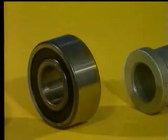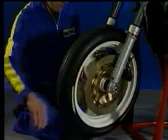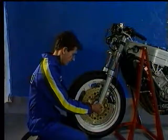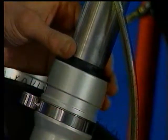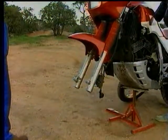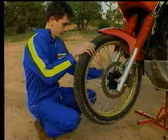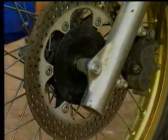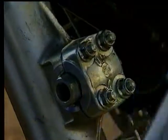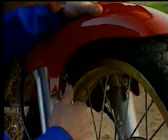The front wheel is mounted on ball bearings. If there is wear or a bearing defect, the wheel will have play on its axle, which can manifest as weave. Check that there is no play and that the wheel spins freely. Move on to the fork to immediately check for any play, and if found, try to determine which element appears to be the source. Observe whether there is play between the tube and the slider on each side. On most motorcycles, play can be caused by incorrect tightening of the fork bridge, leading to misalignment of the sliders which can cause shimmy. The tightening sequence must be followed: first the wheel axle, then work the fork, then tighten the sliders on the wheel axle, and finally tighten the fork bridge.